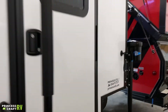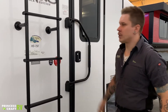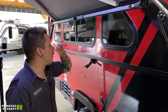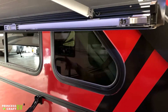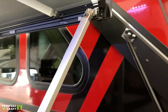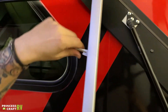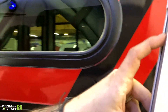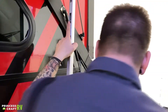Stepping up here, we have a standard RV-style handrail that locks in the out position and folds against the door. Here we have your awning — it's an eight-foot awning. You have two legs up here that fold out; we pivot that out with your thumb to allow it to come down. You do have a locking tab, and once we reach the final position we go ahead and lock that. There is also a secondary detent that extends it further. We can extend this all the way down and stake it into the ground, or the more popular option is coming back to the trailer-bound connection.